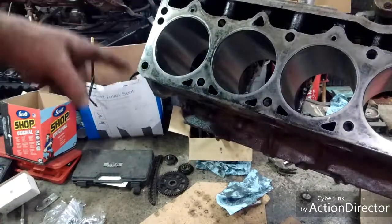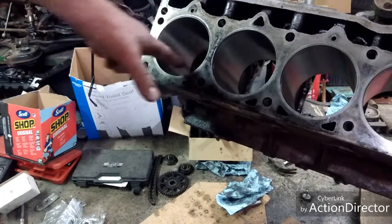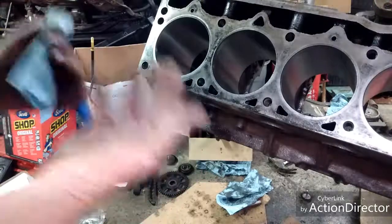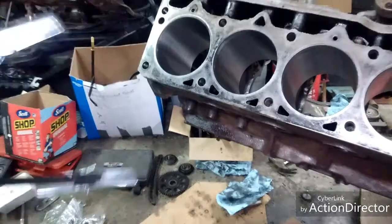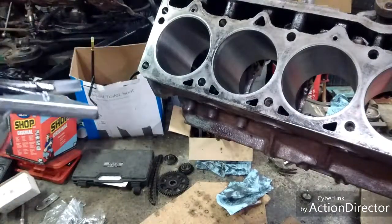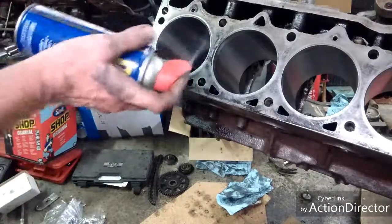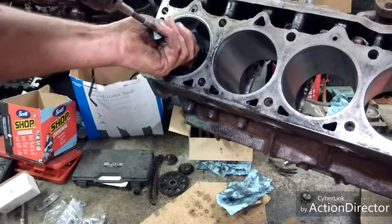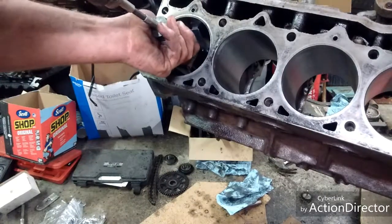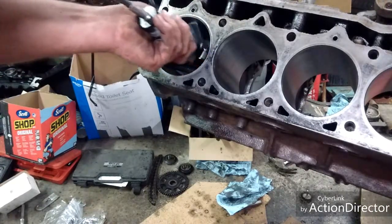Now when I was honing that out, all of these little ridges in here — they're very minute, but they're all kind of going straight. What you want to do is crosshatch this, so when the new piston rings wear in, they wear in right. Because those little ridges, even though they're minute, could cause your rings to fail a lot faster. So go ahead and clean up your stones again, spray some more WD-40 in there. Then what you want to do is go the whole length of the cylinder — which isn't much — and go like this, kind of quick, so you get a cross cut.